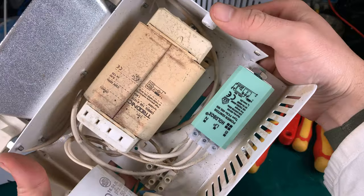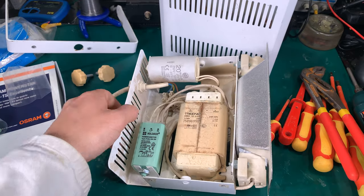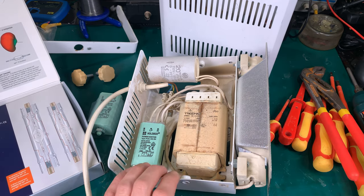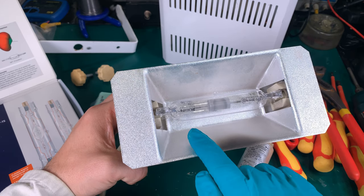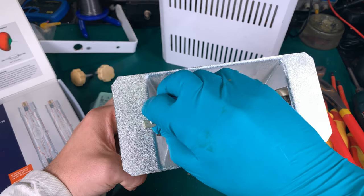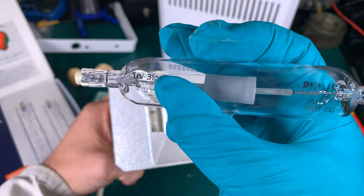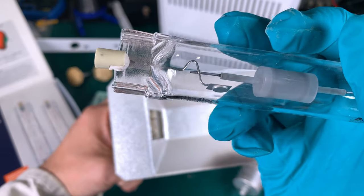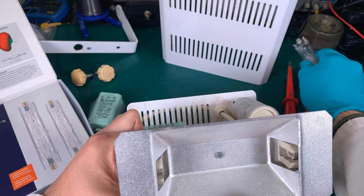Perfect — we've got an absolutely beautiful job on this device. Now let's replace the bulb. I was taught to always use a glove. The reason is that oil from your skin is going to affect the cooling, and you might get a piece of glass that cools down at a different rate, creating stress that may lead to it breaking.